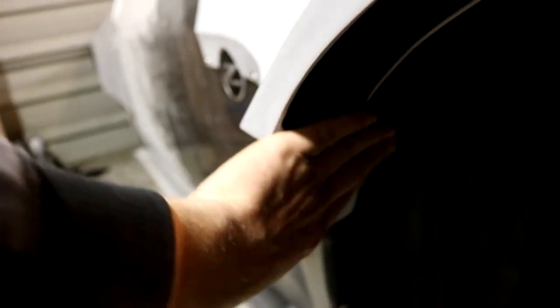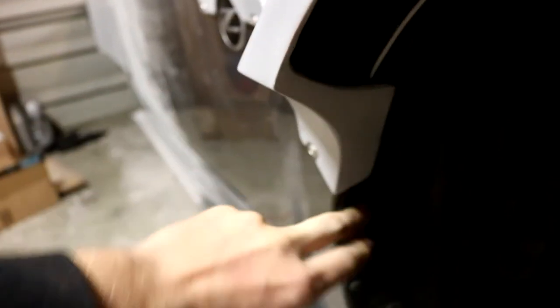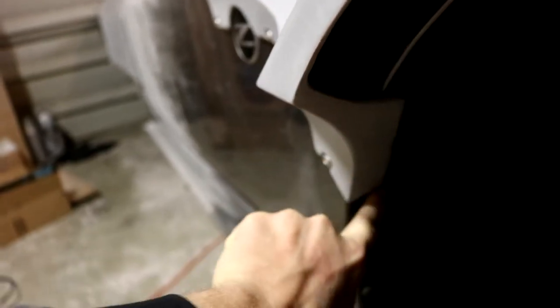I did the exact same thing. I used the packing tape and I laid about 3 layers of packing tape up to this point right here and then just traced these lines. Did the same thing on the other side, right here. Laid it up to about here, so I captured this very important corner line right here. And then the bumper line right there was very important as well. And of course, obviously, this line here.